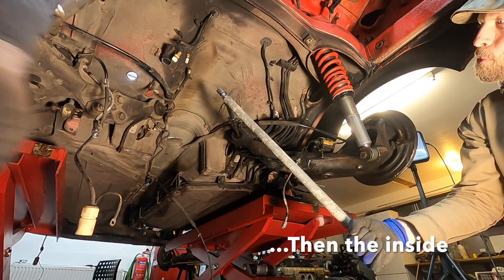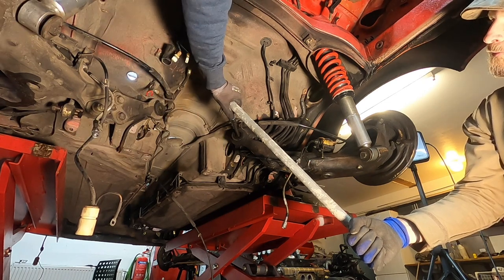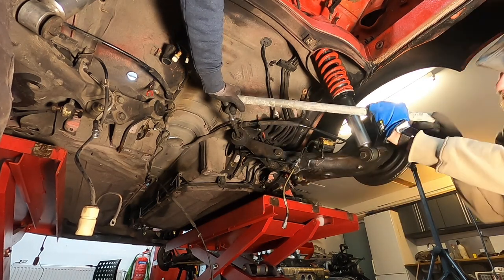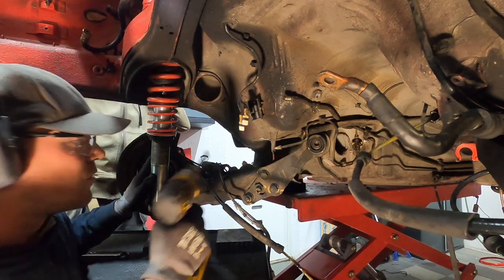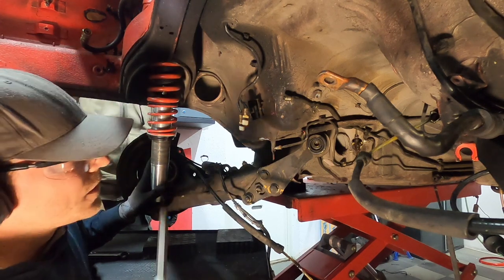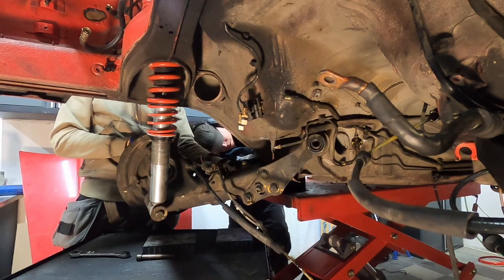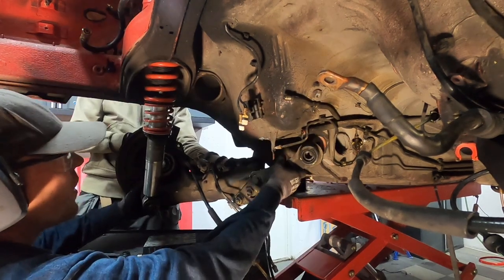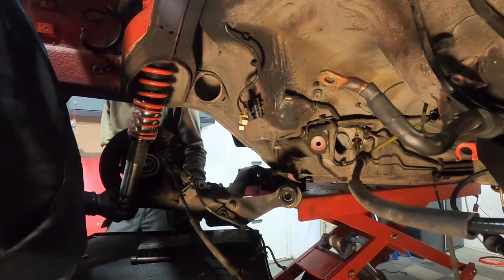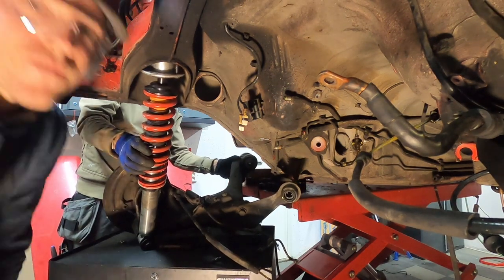Here's another area where great power is needed to untie the inner spring plate — it's coming. Time to drop the rear trailing arm and the suspension here, loosen the coilovers, and everything else is loose, so let's see if we can let it go. Okay, that's how it's done.